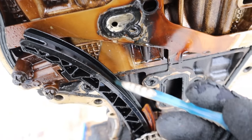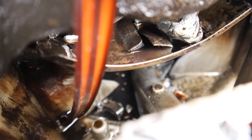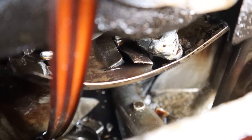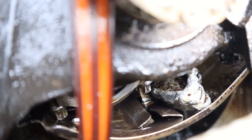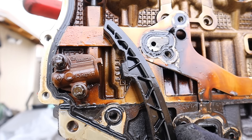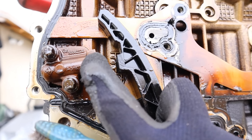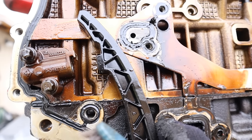The slide that's supposed to be on here where the chain slips against has actually slid down all the way into the oil pan. Just taking a peek inside of there, I can see a lot of debris, a lot of carnage — there's probably chunks of piston inside of there and I can see a connecting rod that's damaged. It appears that that pin was probably the timing chain tensioner. There's usually supposed to be a spring-loaded pin inside of here that would push this timing chain tensioner against the chain — that's not available at the moment.